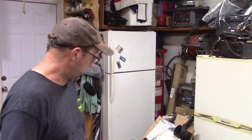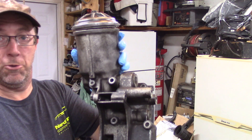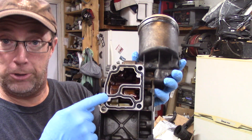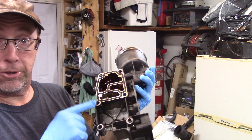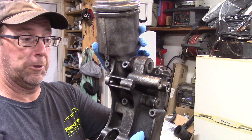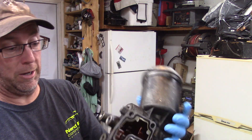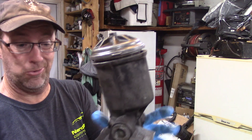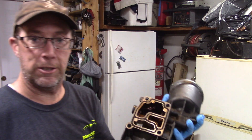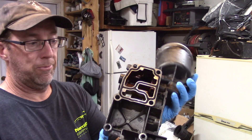Going to an M50 — once you get into the M50, M52, and M54 motors, they don't just have an oil filter that screws onto the block. They have this gem of an oil filter housing adapter. This is your leaky gasket — we've changed this a couple times and it's still leaking. This is a standard oil filter housing adapter for an M50; the ones on my M54 are basically the same part. The top's plastic. The gasket's the same and they all leak over time.